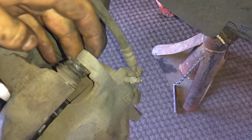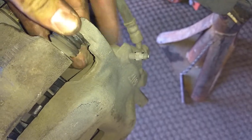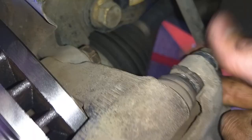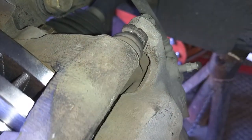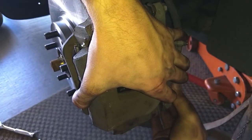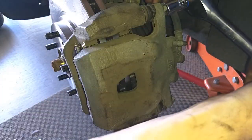When you go to put these bolts in, notice there's a flat surface on the slide — you need to match that to the flat surface on the bracket. Same on the bottom: there's a flat area, so just make that fit nicely. Then thread your bolts in — these are the 14-millimeter ones.